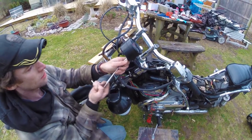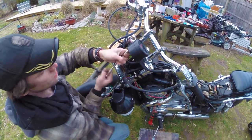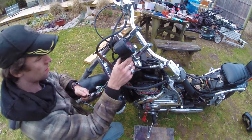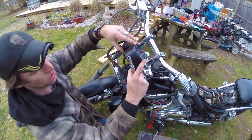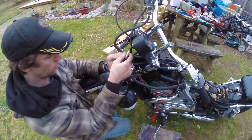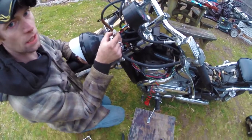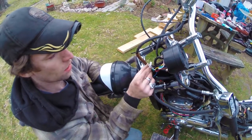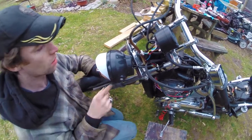It's going to give it a slight dampening effect and also a slight bit of tension so these bolts don't come loose. Then we just snap our big connector into it. This little pigtail is actually for the speedometer sensor — this is an electromagnetic speedometer pickup, so I have to put that somewhere down near the brake rotor. I'll do that in a little bit, but for now this is all for testing purposes.